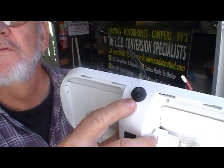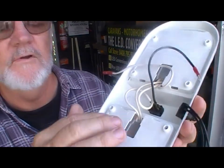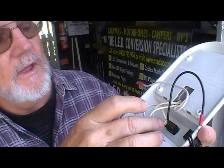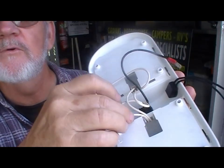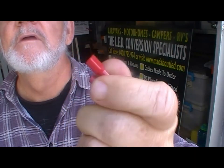Welcome to my mobile workshop. I've drilled the 10mm hole to take the switch and fitted the switch into the side of the unit. What I've got to do now is follow these two wires — on the original switch the black wire is the power coming in, and on the opposite pole is the positive wire that takes power to both of the globes. We only want to take power to one or both using the switch, so we're going to break this switch wire using some quick connectors.